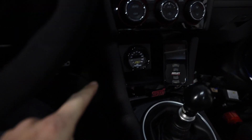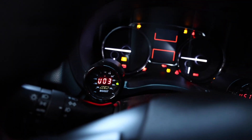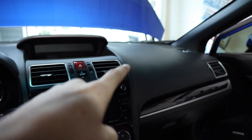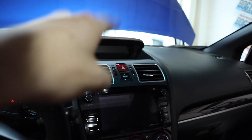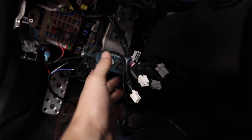So I just went through and ran the power for the oil pressure gauge right there down to where I had the power for all my other gauges. Now in theory, if I turn this on, that gauge should turn on. Look at that! So now we have boost, air fuel ratio, and oil pressure right there. So now what we need to do is take that sensor wire and run it up into the engine bay and then get it tapped into the rear oil galley up there. I'm going to get this mess cleaned up real quick, just zip tie all the wires down here up, back, and away.